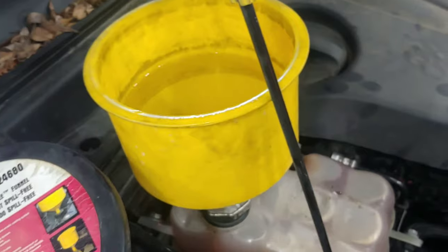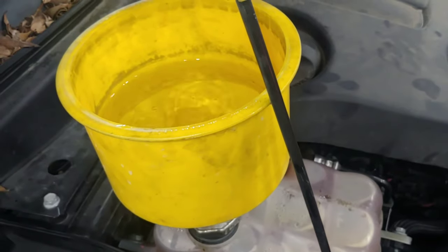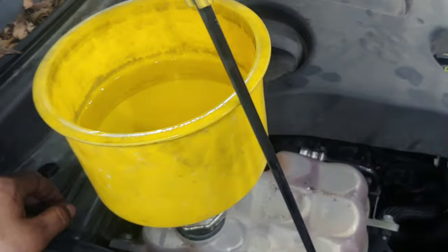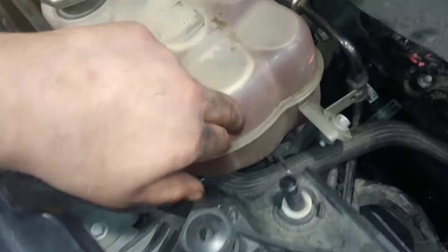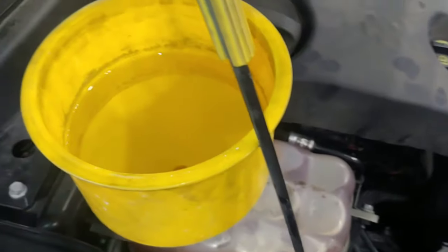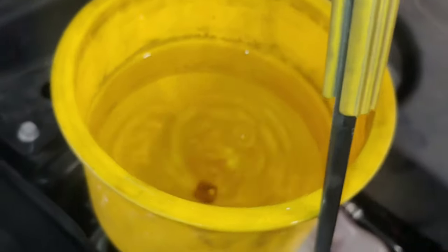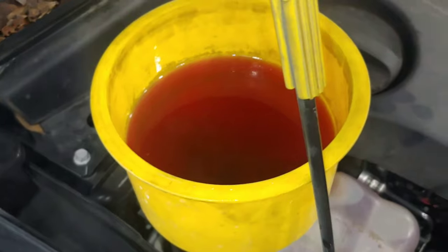I'm just using water since I hardly lost any coolant. Sometimes you can do more harm mixing different kinds of coolant — if you just lost a little bit, it's safe enough to add water. It's supposed to be 50% coolant, 50% water anyway, and the reservoir still has plenty of concentrated coolant in there. I'm going to squeeze the radiator hose and you can see the air coming out. You want to let it run until you see no bubbles at all. It's been running for a couple minutes and it finally stopped bubbling.